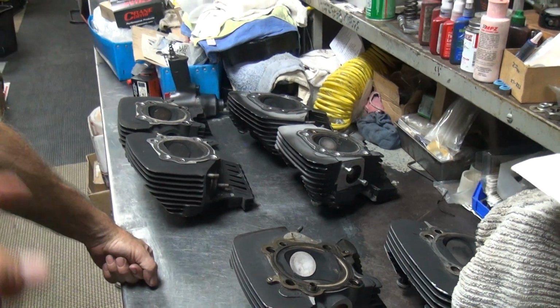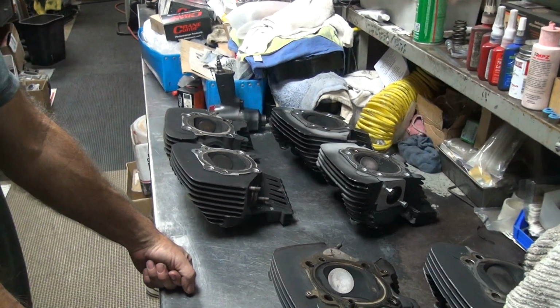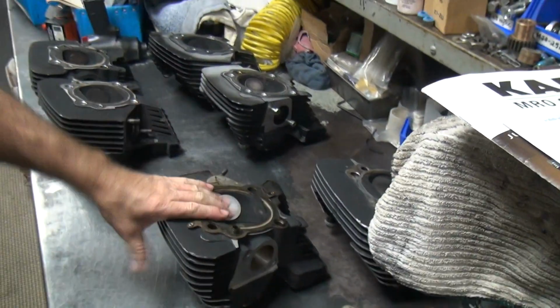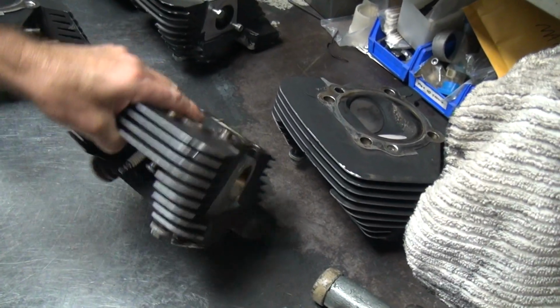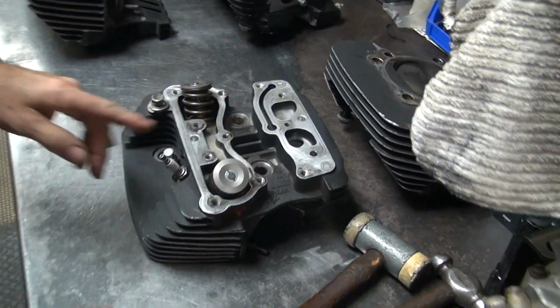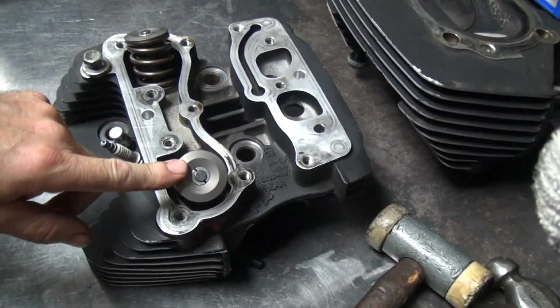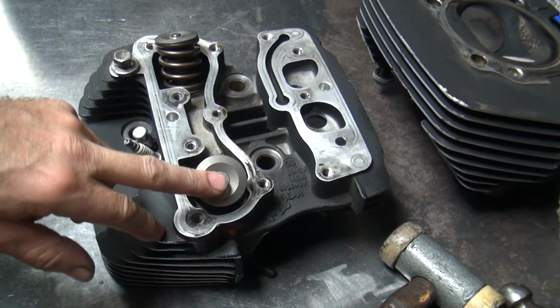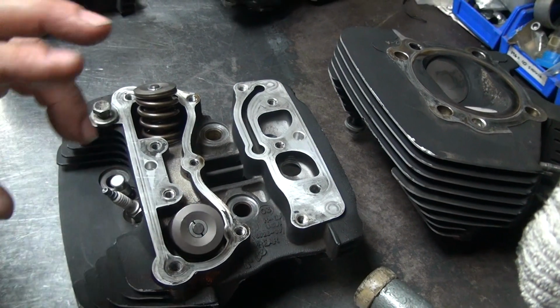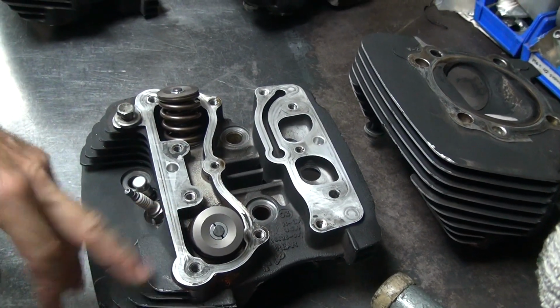600, I think, or 619. But those have been run before. 619. Yeah, but they weren't run very long. These are all twin cams. So this one here is a 124 motor. No, that one's a 99, no, 98. This is the 124. I just got done putting titanium Crane springs in here. This was set up for a 600 lift cam, so now he wants to put a 640 cam in this bike.